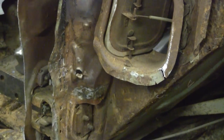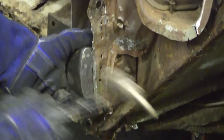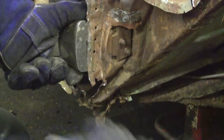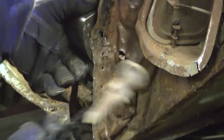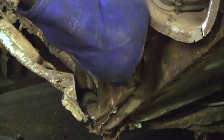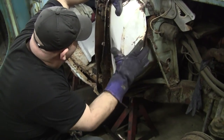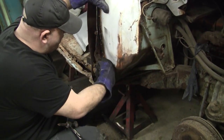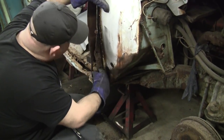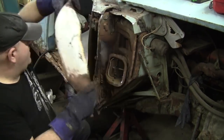Keep in mind, folks, that pliable metal is very, very pliable — you can shape it any way you want, you just have to be very careful. Now I'm going to use a flat edge, a little bit flatter on the bottom side. As you can see, that came right to life. The purpose of making this flat here is so when we bend it to contour the drip edge, all on the edge has to fit nice and snug and straight. To achieve this, we're going to use this piece of metal. Once we have straightened it, you can see it fits like so up top and on the bottom. Then we flatten this, then we bend it straight — bending it straight will give us the ability to put it down in here and weld straight to the back side, and then the front outer panel, which you'll see later in the video, goes to the piece we are now straightening. So it will give us a nice body line with a contour and hopefully some good results.